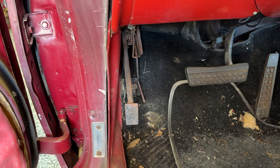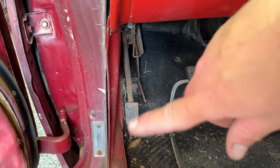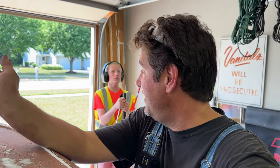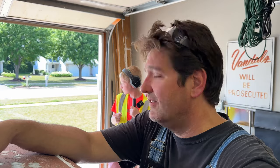There's a small drum on the back of the transmission — if you're familiar with these transmissions, it also hits a relay that turns the parking brake on up here. I don't know if that cable's any good, I don't know if that drum's even got shoes in it. As a precaution, we're going to jack the back of the car up and put it on jack stands, in case the thing does fire up and it's in gear. I don't want to run over Alex or myself, and I also don't want it to run across the street into the neighbor's house — especially since it doesn't have any brakes whatsoever.